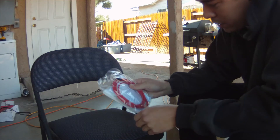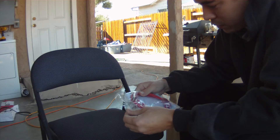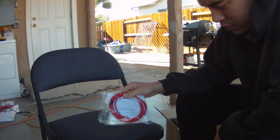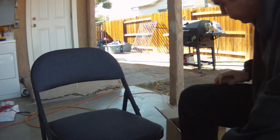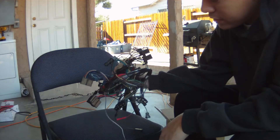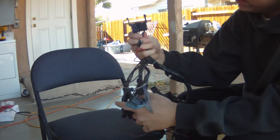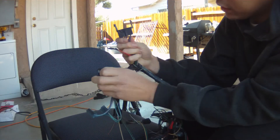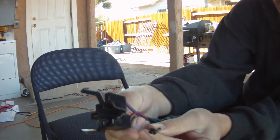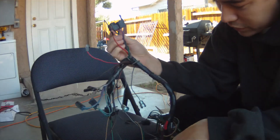And then this was probably the worst wire in the vehicle, so they made me one over at M&H. This is the wire that goes directly from the battery to the horn relay. And this is the old dash harness — you can see this red wire here comes from the battery to the horn relay to the ignition. I don't know how well you can see that, but it melted its way out of the clip and grounded. That's where the fire started.